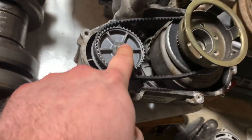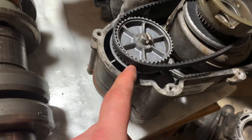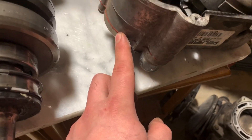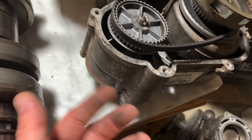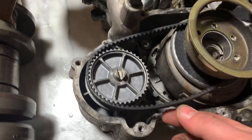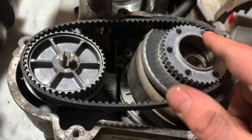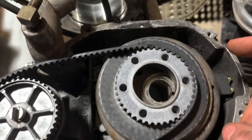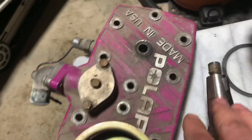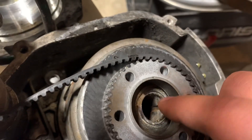This little notch right here actually drives your oil pump, and this big gear goes into a shaft which turns an impeller on the backside. I don't have one of these separate right now, but just imagine a plastic impeller — it spins and moves your coolant. What turns all this is basically a vacuum belt, which is turned by the recoil — that's how you start your sled — but it's run by this, which is bolted to your magneto below it, and that is spun by the crankshaft. That's why you have your Woodruff key here — that little key goes in that slot there and spins all this.